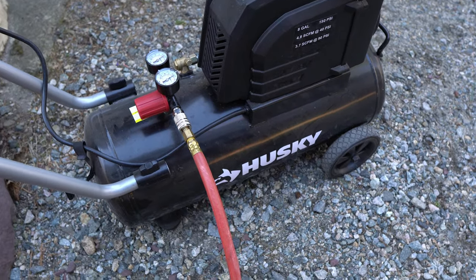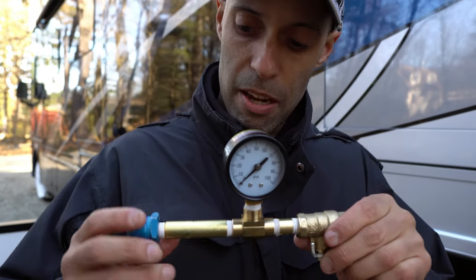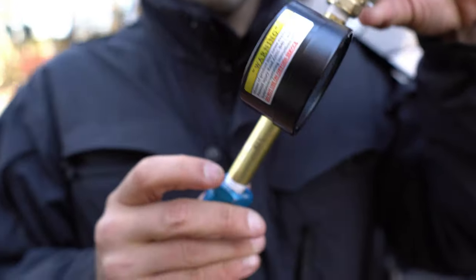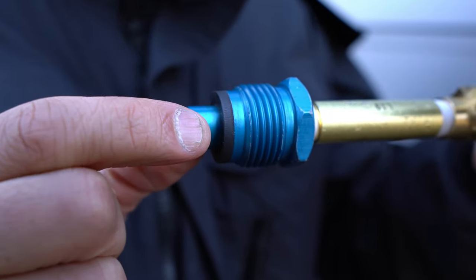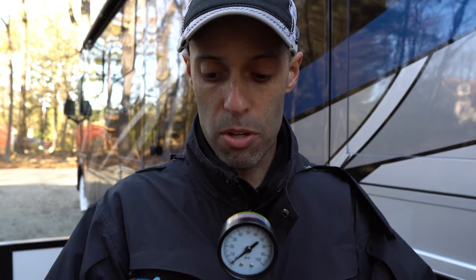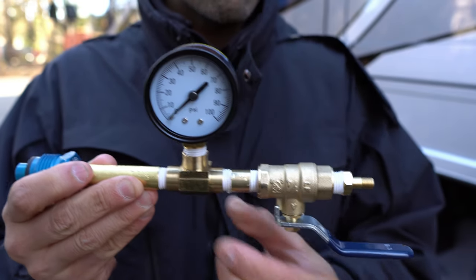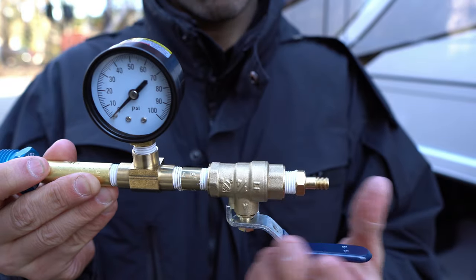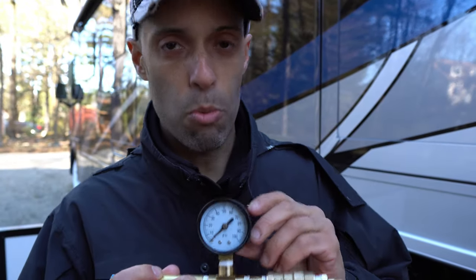What are you going to need to do this? It's really simple and it's going to take you about 10 minutes. You're going to need an air compressor or some kind of source to blow air through your freshwater system. You'll need a homemade test kit. The most important part is a specific test plug, because the end of it will push the check valve that's in your freshwater intake. The rest of the fittings you can get at big box stores: a quarter inch nipple, about three inches long, a quarter inch tee, a quarter inch manual shutoff valve, a quarter inch straight valve, and a pressure gauge up top rated up to 100 pounds.